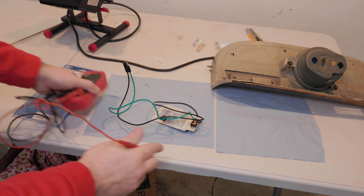I'm going to check the green wire — there should be a short passing through, there should be connectivity. You hear that? Now we're going to check this black wire, which runs from here all the way down directly to this switch. We have nothing, which is unfortunate because without this I can't get it together. The solder joint in there looks fine — it's something on this connector end that just isn't working. I might just buy another connector and do it myself rather than work with this. These are simple trailer connectors — let's go ahead and replace it.